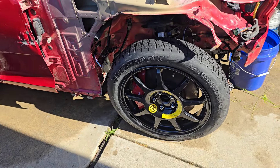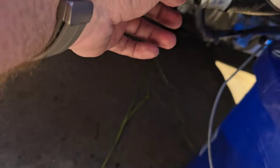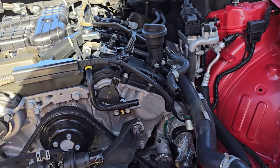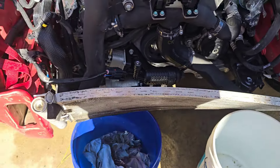Once I saw the frame needed to get straightened out, I moved on and cleaned the engine. The air box for this side was fine — it broke the little inlet right here but the box itself was fine. The charge tube over here got smashed — I'm gonna straighten that and replace it. I have the radiator on order, I found a condenser for it, and the automatic transmission cooler — I got all those on order. I should have gotten the core support this weekend but it's delayed from the dealer.